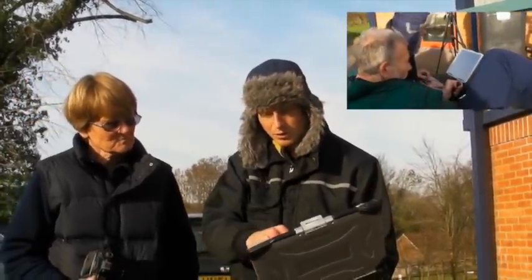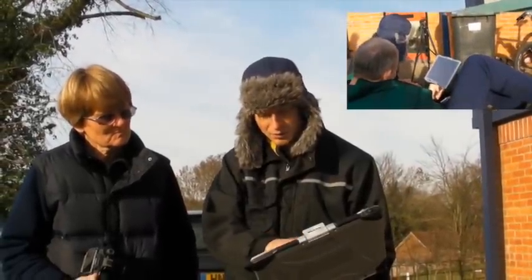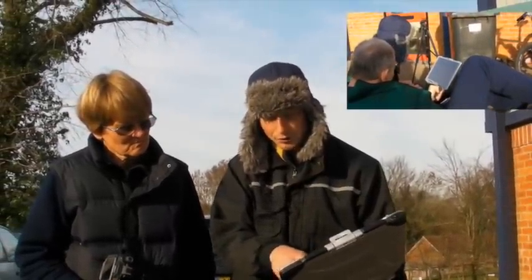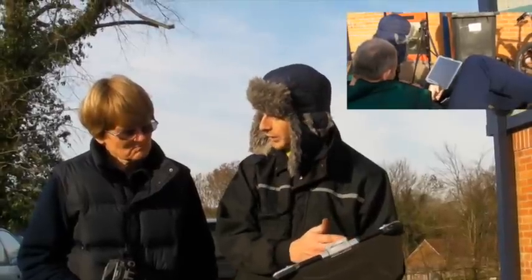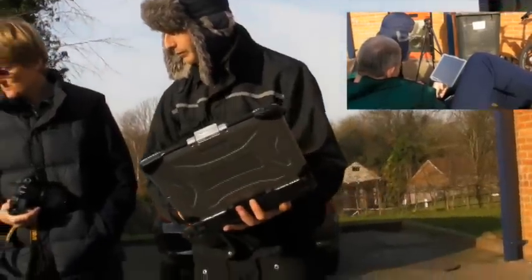But as I say, we've still got a little bit more room we can play with on the base activation current, and we can also put the turn on delay a little bit further down as well, just in case you want quite a big adjustment to suit your situation.